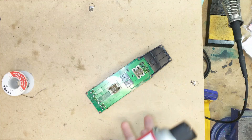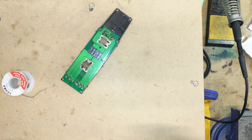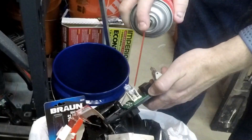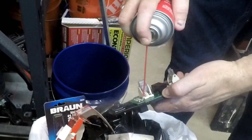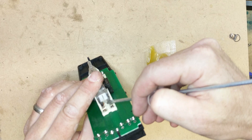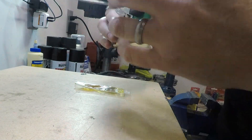After soldering is complete, a thorough cleaning is helpful. This will flush old dirty grease out of the switch contacts, so make sure to replenish it with clean grease. A light dielectric grease, sold in small packets for greasing spark plug boots, works pretty well here.